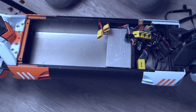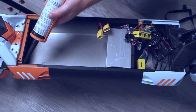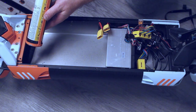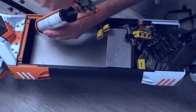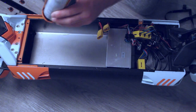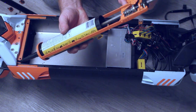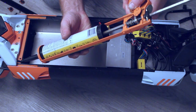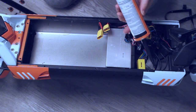I'll run sealant around the top corners of where this back panel joins the scooter, along the bottom and up the side. When I took this out originally I had to clean all the old mastic off — if you've got old mastic it's best to get it out of the way first before you try to seal up. I shall now seal up this little channel here, which must have been for possibly a cable exit they were thinking of using, maybe to be re-utilised in a future episode.